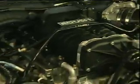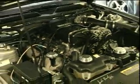On 93 pump gas, it does about 510 wheel horsepower at sea level on a manual transmission car. It's a really good setup. We've got a tune to have it survive on the stock motor and the stock trans. I know a lot of people are really worried about that automatic trans, but yes, she will be fine.